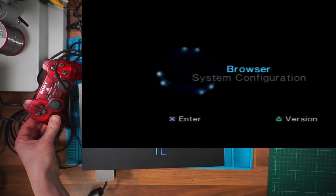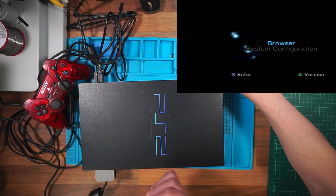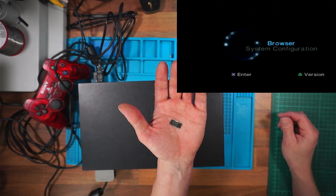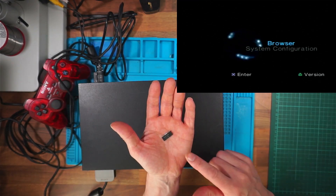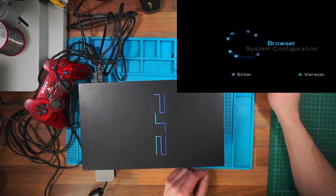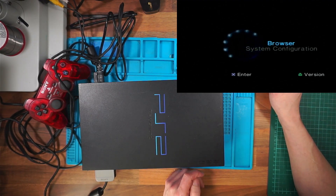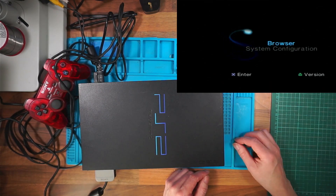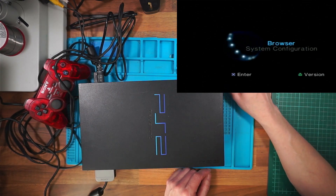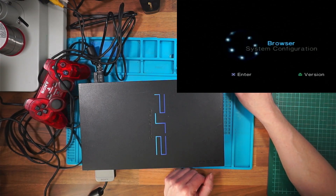I'm going to switch it straight back off. Switch on - got a red light here and fan spin - and there it's working, I've got display. I've set the timer on the clock and put a new battery in, so the clock should be right - 10:51, that's right, so the clock's working. I've got a memory card in here so the memory card's working fine. The system seems to be working okay. Obviously I can't test the optical drive because I've removed the shorted driver chip - I'm still not convinced that chip was causing the no-display issue. If you know that to be accurate, let us know in the comments.